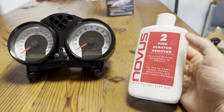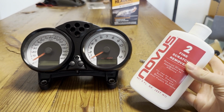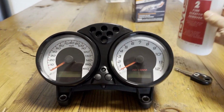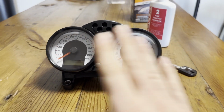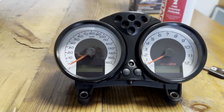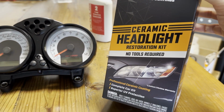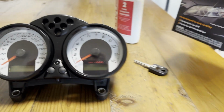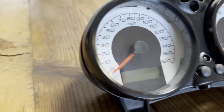So I used step 2 fine scratch remover from Novus. I will put a link in the description below. For this, I really just put it on a microfiber towel and then polished the lens from the inside and outside. And after that, you have a very fine, hazed, polished material, and you need to put a new clear coat on. And I still had this Cerakote ceramic headlight restoration kit, which I also used on the Ducati for the headlight, but it has a really nice ceramic coat that I then applied onto these, and you can see no more scratches. It looks really, really clean.